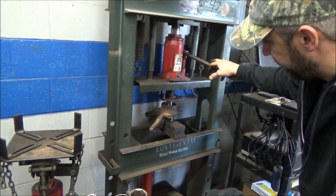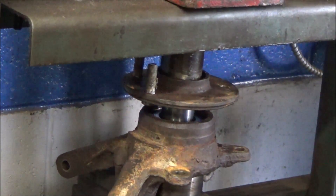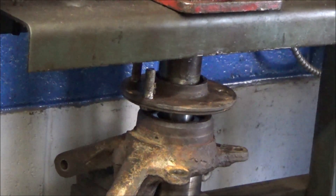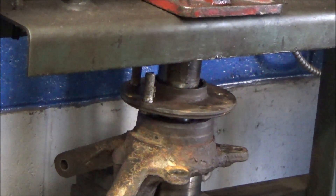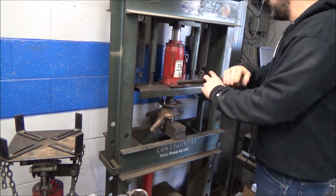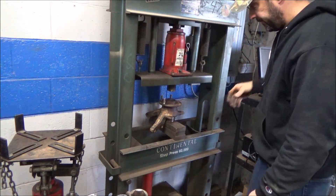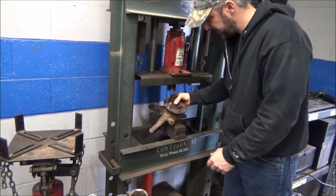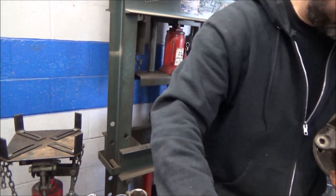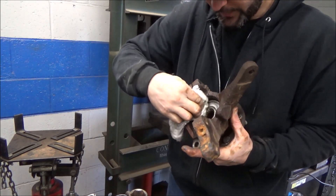These usually start fairly well — you don't usually see this portion getting too off-centered. The other thing — if this was like a Subaru where it would have independent inner and outer seals, some of them have seals, so you want to make sure you don't push it together without first putting your seal in. Snap ring and ABS stuff, dust shield if you had to remove that — there's a lot of things before you put this on. Stop and think, because once you press that on you pretty much own it. There it is — she hit bottom. And we're done. That's it, minus snapping the ring, which is very important. Don't forget that.